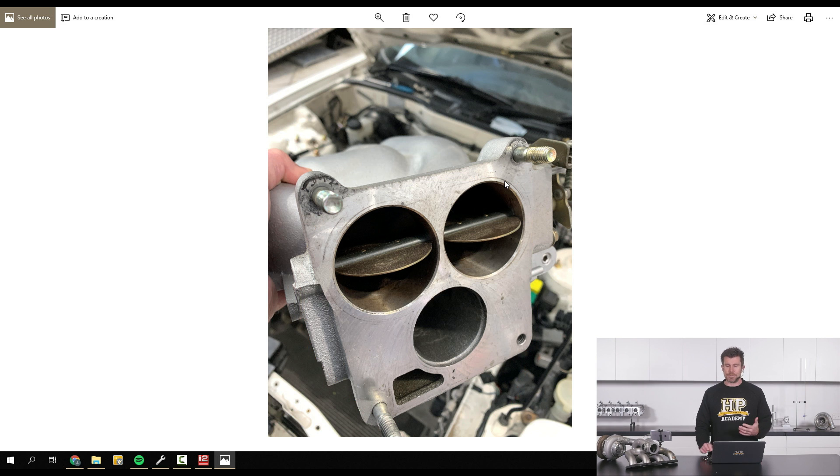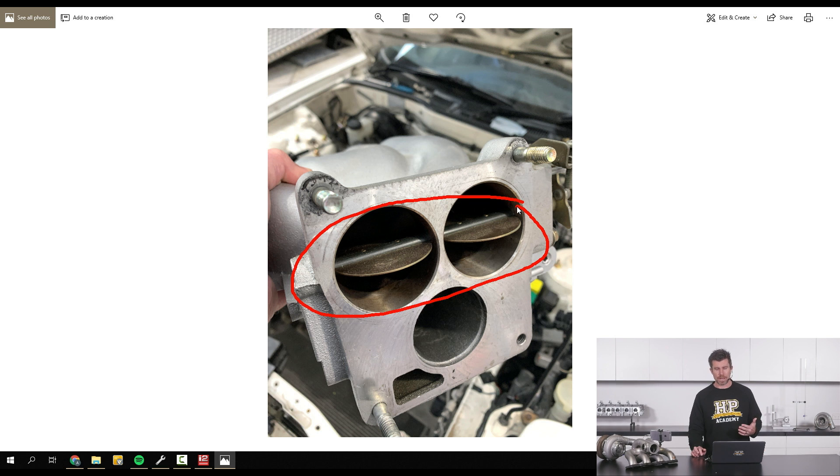The design of this engine comes out of the 90s, so there wasn't the same sort of technology available back then. In an interesting twist, Mazda chose to fit a set of second throttle butterflies in the upper inlet manifold, actuated based on operating conditions. When the engine was cold, these were predominantly closed — kind of like Mazda's way of limiting how much fun you could have with your stone-cold engine. We're going to be removing those secondary butterflies, as it's been shown there can be some small but measurable improvement in air flow.